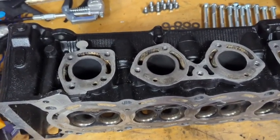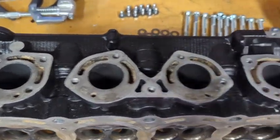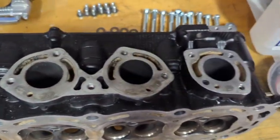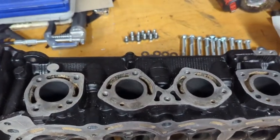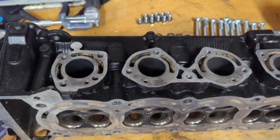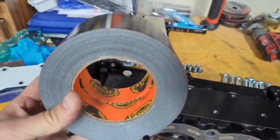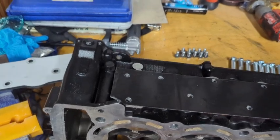After the silicone has dried, clean off the exhaust manifold area really well with 91% isopropyl alcohol and a clean rag — make sure there's no debris that could prevent a good seal. I'll put the tape on and show you where to cut the holes so we can put the plate on next. This is what it should look like when you're done. This is why I went with the thicker Gorilla Tape — about $16 at Home Depot — it's a large roll you can use for other things too.